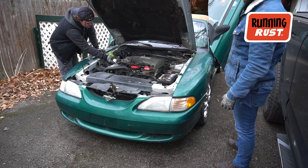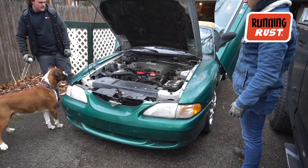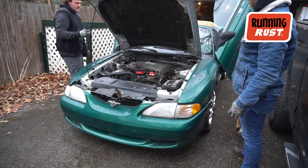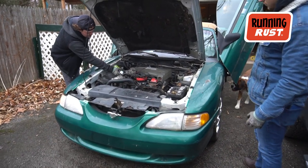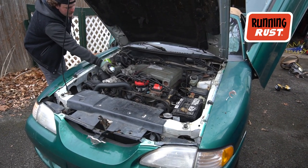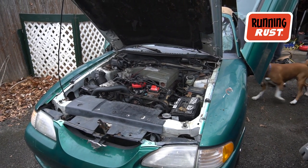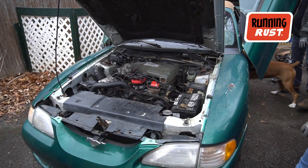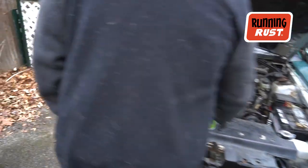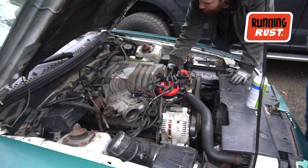Okay, go ahead and spray in there. There you go, that's good. Spray again. It's kind of a slow crank. We should probably put a... It has air. It has fuel — it was sucking all this in too. It probably doesn't have spark. There's a reason it doesn't have spark. Well, the good news is it cranks. It does crank.